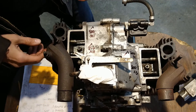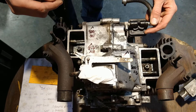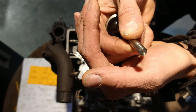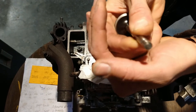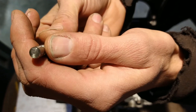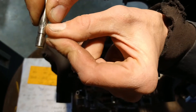What I've done is bolted the jugs back on, torqued them down, and then came through with a feeler gauge to check what the clearances were. Before doing that I took the valve stem to the piston ring filer and just faced it square — you can see how it has a freshly cut look to it. Just to get the mushroomed end off and make sure it was a flat surface again.